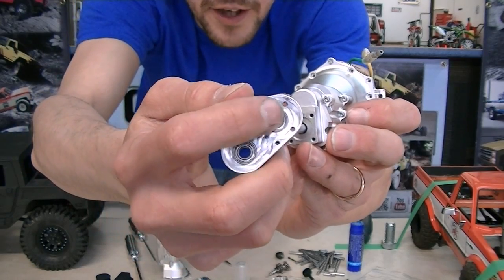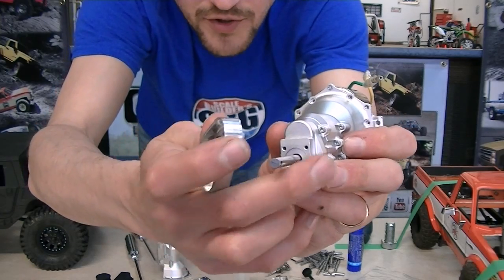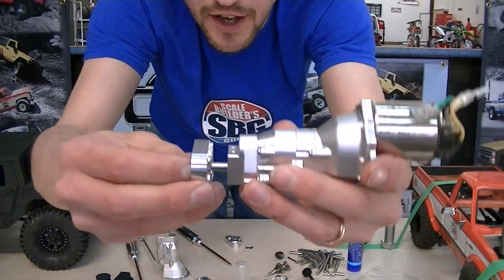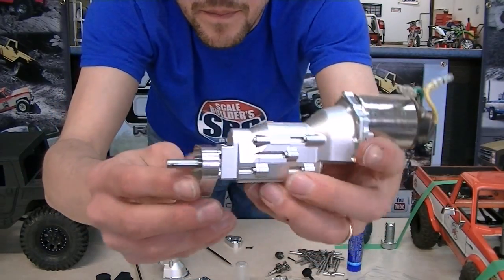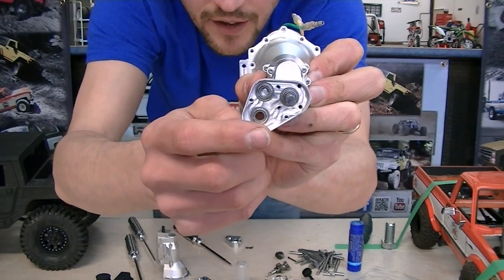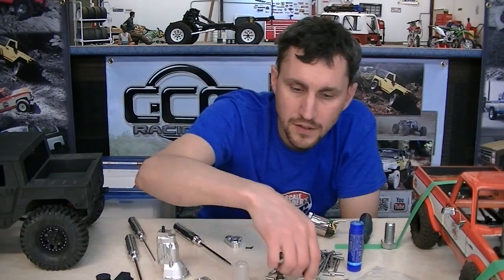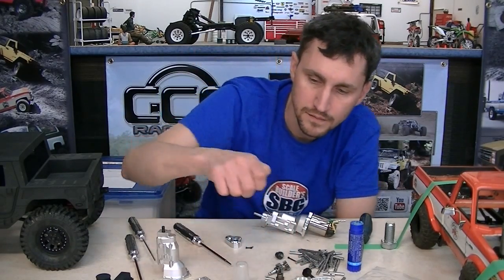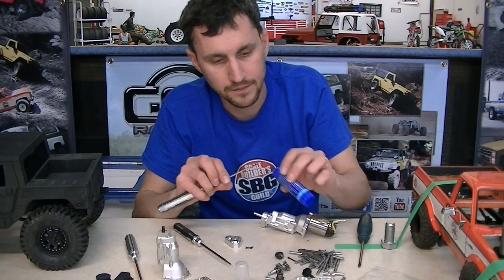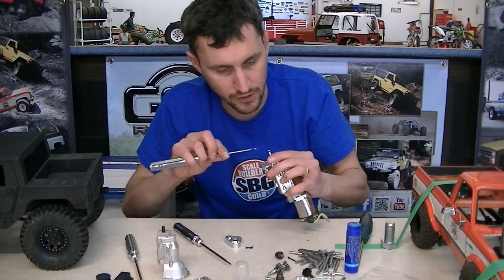See how there are four holes here? Those four holes match up to the four holes on the transmission. Slide the LRT over top of the shaft and line up the four holes, then bolt them in. Put some Loctite in there - you don't want the gears getting crunched by a screw that's backing out.